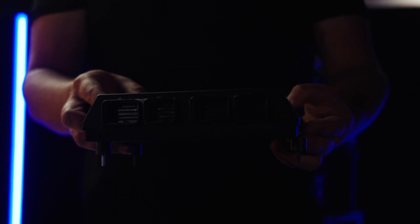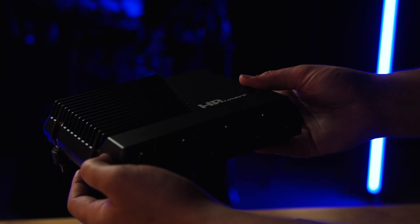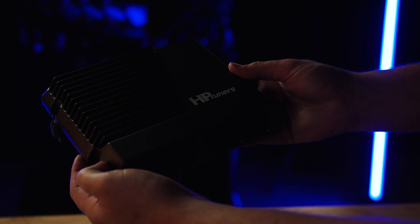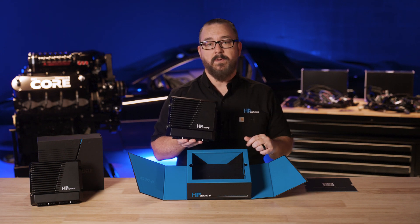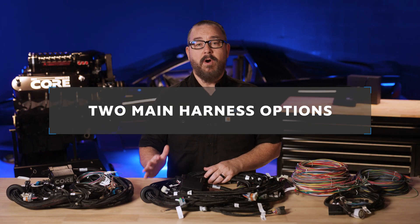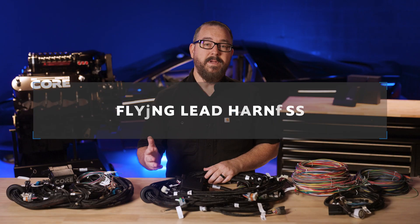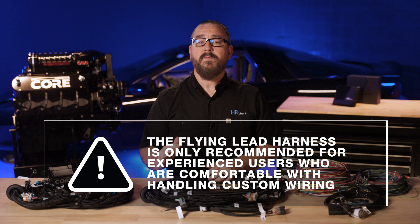The choice is yours. The Core ECU was fully designed in-house from the ground up, taking what we've learned not only from OEM ECUs, but also from what we've seen in the market and our tuning experience. This gives us a level of flexibility and allows us to adapt quickly, improve our processes, and implement new features. Everything from the software, firmware, strategy — every single aspect is done here at HP Tuners. For this product launch, we'll support the 24x and 58x GM LS applications, referring to the trigger pattern of the Gen 3 and Gen 4 engines. We support the entire lifecycle of the GM LS engine and offer two main harness options. We will soon roll out more engine harnesses to cover other platforms, so be sure to subscribe to get notified when those are released. For experienced customers or professional shops wanting something custom, we offer a flying lead harness. This comes with connectors and wires, giving you full control over how you run your engine sensors, fuel injectors, and other parts of your harness. We recommend this option only for experienced users comfortable with handling a custom wiring project.